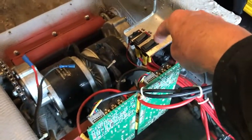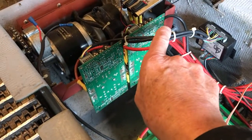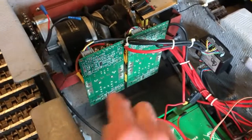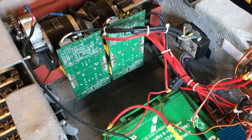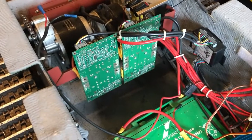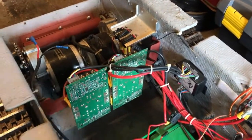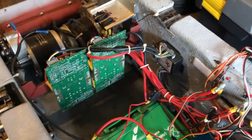We've got your on-off switches here, and we've got these 2 rather large 4QD speed controller boards, which are exposed unfortunately, which is a bit of a worry. I think that's because they wanted to ensure that a lot of air could get to them, so they didn't overheat. But I think what I'll do with those is give them a conformal coating to protect them from any water and sand, and then maybe rig up some sort of cover over there. We've got the controller for the speed controllers for each board.